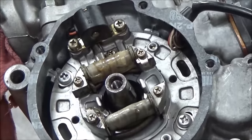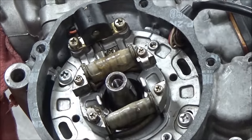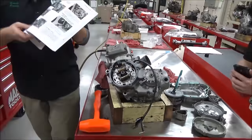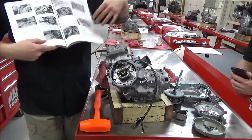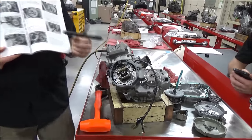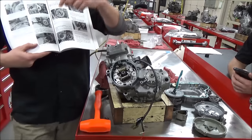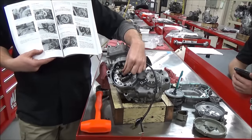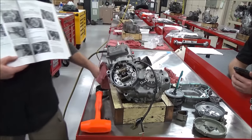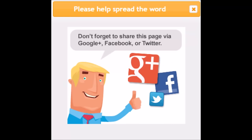That's a cool trick. One of the things we were just talking about with the students today is that sometimes you've got to just learn things — every mechanic should know this. You probably wonder why the factory manual doesn't mention it. Well, it might be the same exact tool, or maybe not. We're using a K&L brand tool, and if I use the OEM Kawasaki factory tool, maybe it's wider. All I know is if we had shoved that in there without the washer, we would have ruined it — we wouldn't have been able to reassemble, we'd have ruined the threads.